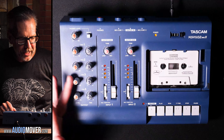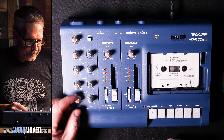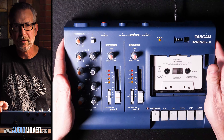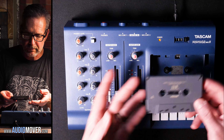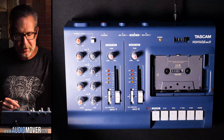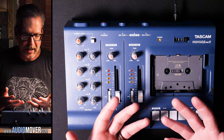After a musician recorded on here, they would create a mix and output it through the left and right output right there. If we were just recording a normal cassette tape, we would turn down side B, and then on side A pan to the left and pan to the right, and then we'd have left and right coming out there. We'd run those into one of our audio interfaces into a computer, hit play, and digitize. Because they have all four recorded, if they were to play it on a regular tape deck they'd hear track one and track two going forward, and when they flip the tape over they'd hear track three and track four going backward.